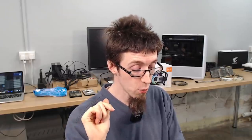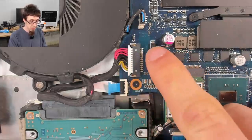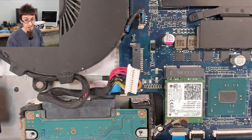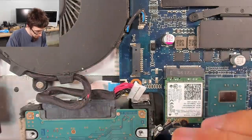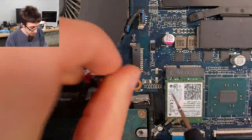If the diode has gone bang, it probably saved the laptop from something worse. While it might appear like it's sabotaging the laptop, it more likely saved the motherboard. Either way, we're going to replace it. Before going further, I'll disconnect the DC jack and double-check the short circuit disappears, just in case the short is inside the jack itself. In continuity mode - still shorted negative to positive on the board, but the DC jack itself is not shorted. So the jack is fine and the diode on the board has blown.